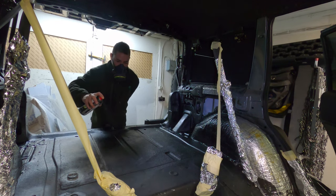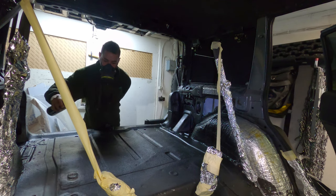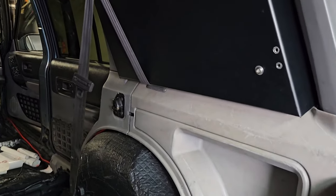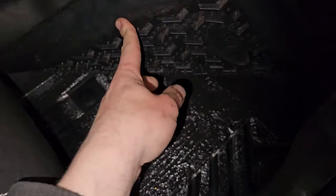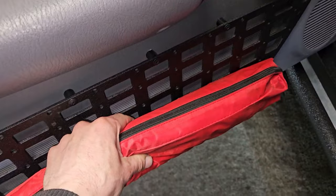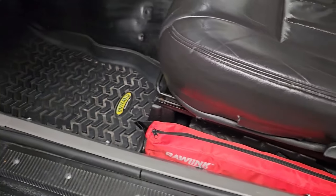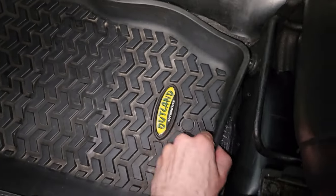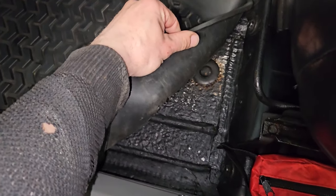Once you've dealt with all of that and got the carpet out, I would strongly advise you don't put the carpet back in. On this vehicle I've used silent coat panels, foam in some areas, and other types of sound insulation. On the footwell it's just plates bonded to a wrapped liner. Fix those silent coat panels down with a heat gun so the bitumen underneath the aluminium sheet is actually melting and bonding to the paint - that way you minimise moisture getting underneath. You can put removable mats or foam pieces down over the top, and being able to pull all the mats out and let it air out will save the vehicle.